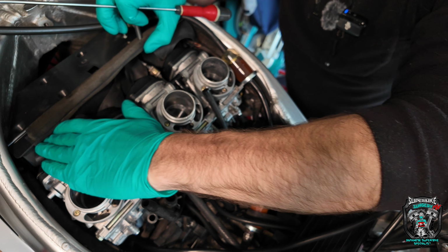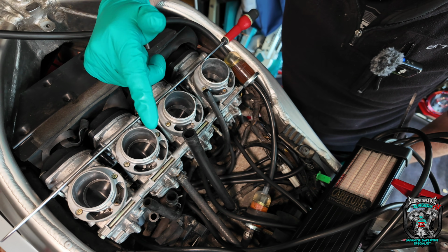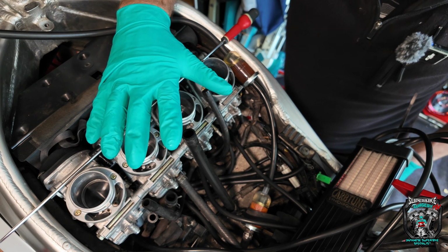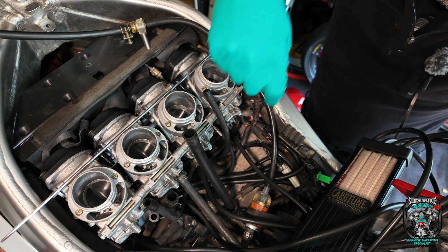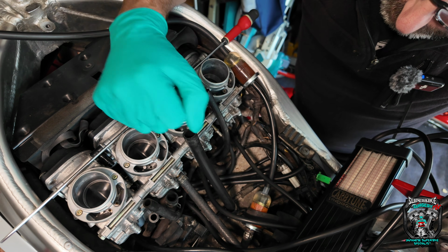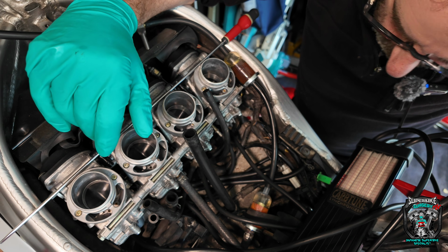So it stood for years and years and years. However, I already know that the owner has tried to start it and it cranks over okay. So this isn't first turn of the crankshaft. If it was me and it had been stood for however many years it stood for, they're easy to get to. There's a bung on the end of the crankshaft. I'd probably, when the plugs were out, have turned it over by hand, just with a ratchet, just because. But that ship has already sailed, so I'm just going to go straight in and try and get it to start.